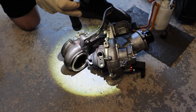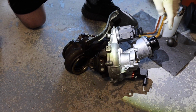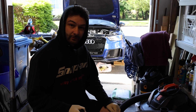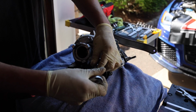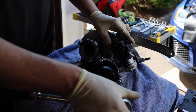It's a little concerning. I'm gonna have to look into it a little bit more, but for the video's sake, we're gonna swap this over to the new one, and then really it's just gonna be a reverse procedure. We'll start swapping this stuff over. Pretty much like I was mentioning, it's time to swap some things over. We're gonna take this turbo muffler delete by EQT and take those out by those Allen bolts there, break them loose.